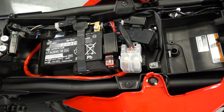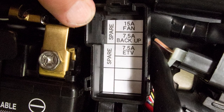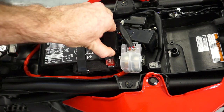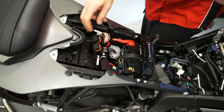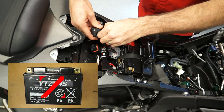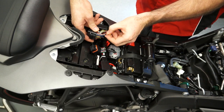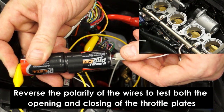Start by checking the ETV fuse, normally found in the secondary fuse block. Reversing the battery terminals during installation is a frequent cause of this failure, but battery connection and condition should also be inspected. To test the drive motor, use the wiring diagram to locate the two wires used to power it, remove them from the ECU connector, and use a 3 volt battery to operate it — two C cell batteries taped in series works great. Never use a 12 volt battery, as you will permanently damage the drive motor or its gear system. These parts are not serviceable and are only available with a new throttle body set. Only slight movement is required to verify that the motor is operating correctly.